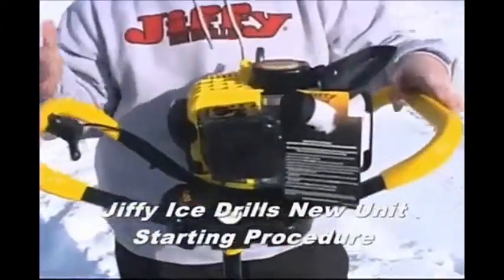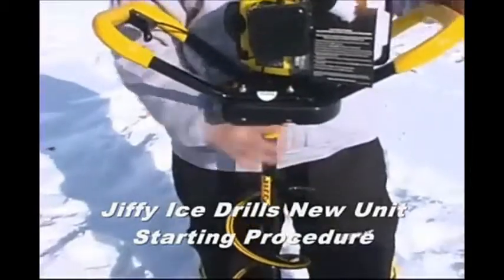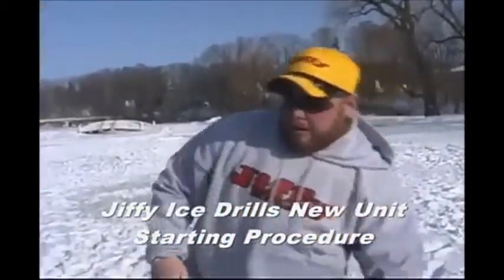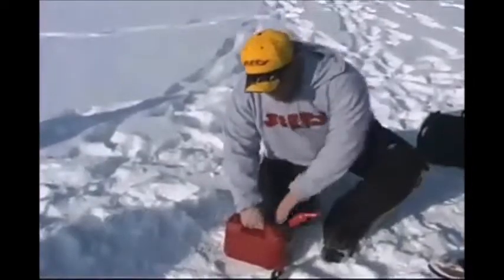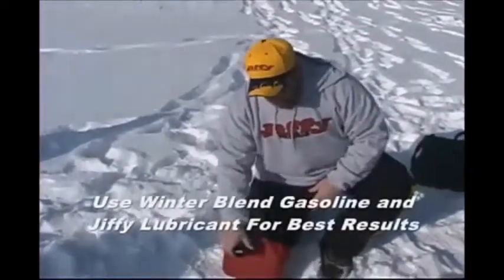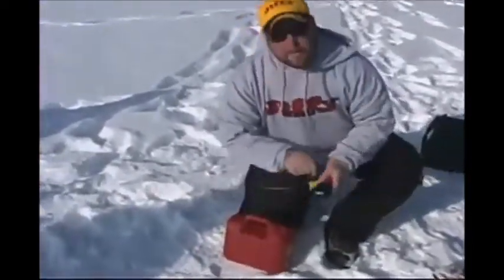What we're going to do is we just took it out of the box, we put the auger on the head with the quick connect. That's ready to go. Now we're going to go to the gas station and pick up a brand new 1 gallon of gas, which you want to pick up right at the beginning of the ice season. The reason being is it's more of a winter blend. There's more butane in it, it burns faster, and it starts easier. It's better for these kinds of drills.